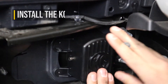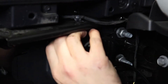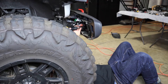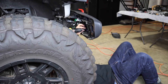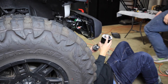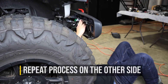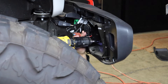Put the KC G4 fog light into position and reinstall the four factory screws and attach the wiring harness. In order to properly aim your fog lights, work on one side at a time. Once you have one of the KCs installed, turn on the fog lights and aim your new beam cutoff line to be at the exact same height as the beam cutoff line from the factory fog light on the opposite side. You can do this by parking about 15 to 20 feet away from a wall and then turning the adjustment screw on the back of the G4 fog light to get it aimed perfectly. Once the new fog light is aimed, repeat the same process on the other side to remove the other factory fog light, reinstall the KC G4 fog light, and aim it using the exact same method.